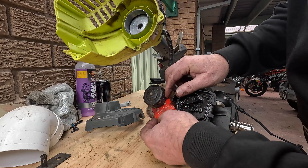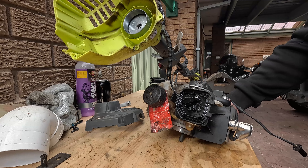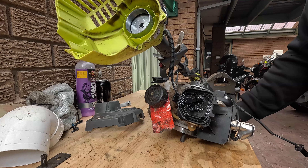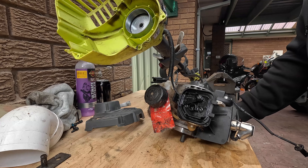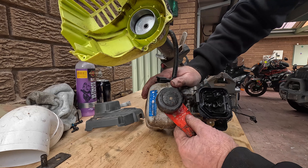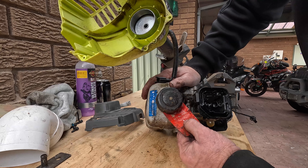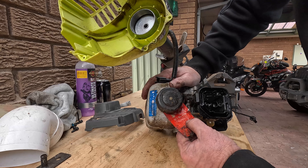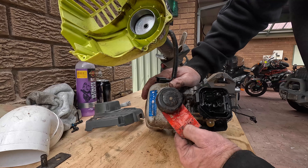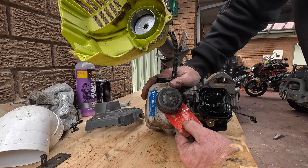One of the most important things with a two-stroke is keep your mixture correct. Don't underdo it or the thing will heat up and seize. Don't overdo it or it'll oil up and gum up. Make sure everything's always clean. You see all the residue oil in here? That means somebody's been adding oil and hoping it's the right amount rather than measuring correctly. Usually when you buy a machine it tells you on it — it says here 50 to 1 ratio, so that's one part of oil to 50 parts of fuel. I'll take this tank off, clean it out, and put the proper ratio of fuel in.